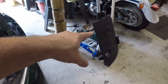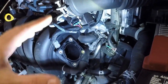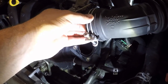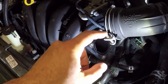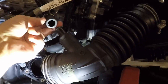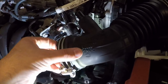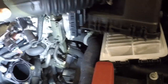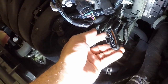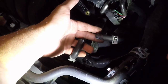I already took the plastic engine cover off — that takes no tools — and I also have the throttle body off already. If you need to do this yourself, it's very simple. First thing is unbolt the intake tube — you can either use a Phillips head screwdriver or a 10 millimeter socket. Then the valve that goes for the breather can you actually pull off by hand, it doesn't take a lot of effort. Then just undo the bolts for the air tube, push it out of the way. You have the electrical connector because this is electronically controlled.